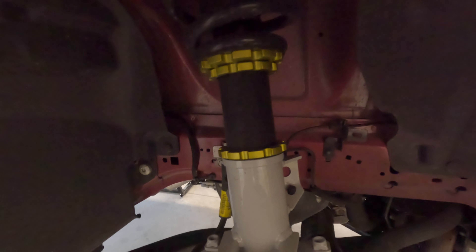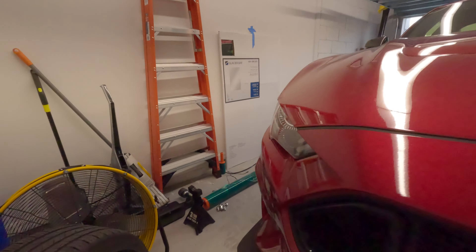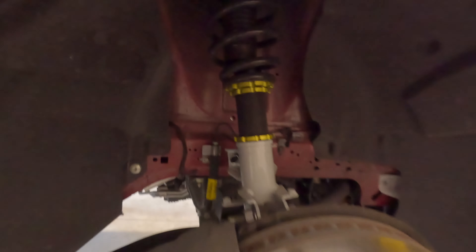I think the first thing we want to do is figure out the adjustments and then apply the anti-seize on the threads. We found that the front driver side collar is about 72.5 millimeters, and the passenger side is roughly around the same length. We're kind of bamboozled by that considering the big height differences we measured. But we think it might be due to different corner weights of the car, so I'm going to look into that and see what's up.